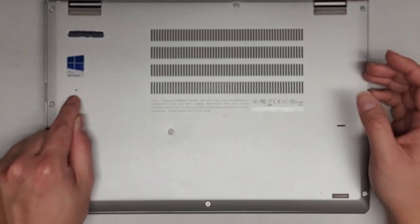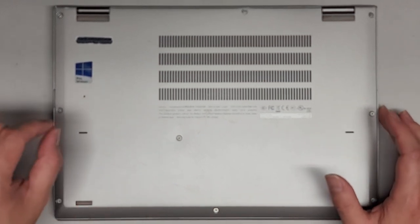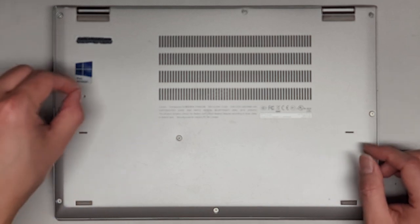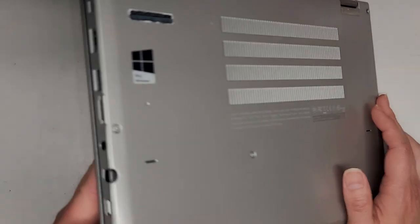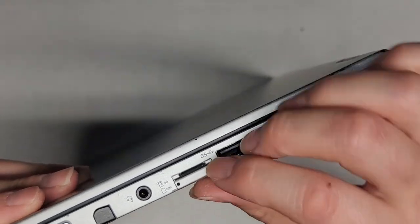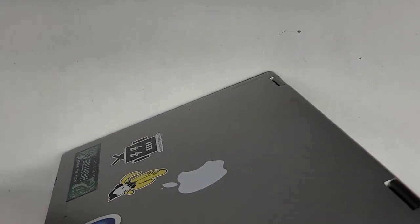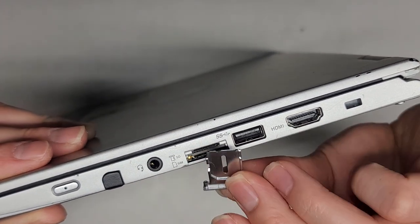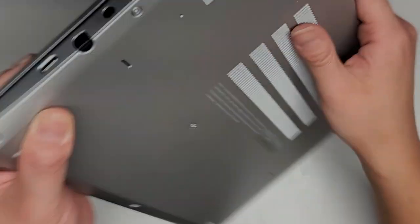There's this little hole here — that's a battery reset button. So if your computer's not turning on, you can try pressing and holding that button using a pin or a folded-out paper clip. You can actually feel it click when you push it. Press and hold for about 15 seconds to drain any residual power. It also looks like there's a SIM card slot here and a micro SD card slot — the micro SD goes at the top, and the SIM goes on this little tray, so you can add a mobile internet connection.